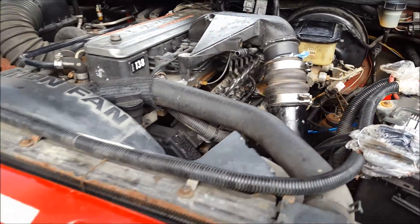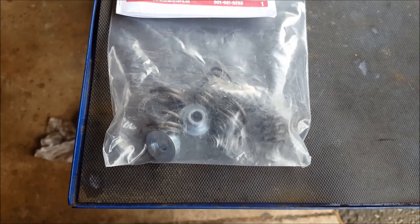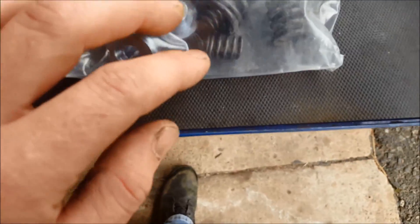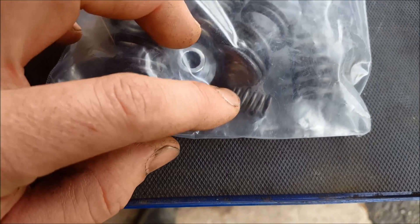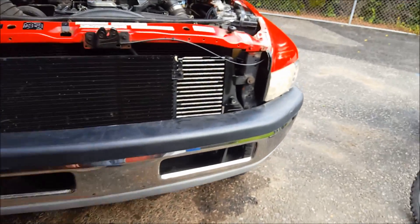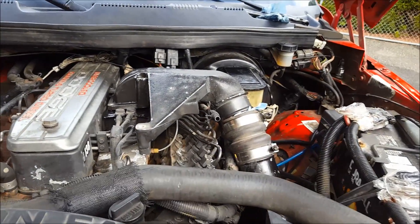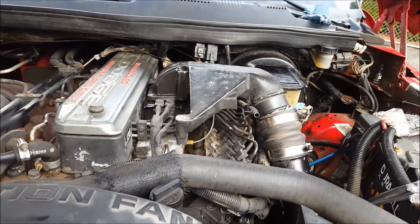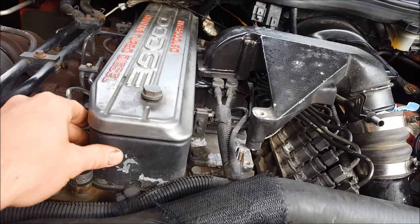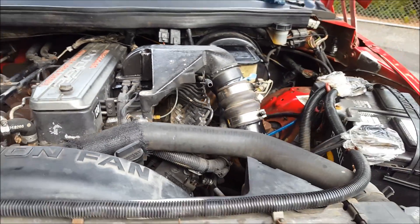Not going to go into a ton of detail, but I'll show you guys the basics. I decided to just get a kit instead of shimming the stock springs because these are cheap enough — I'll put a link in the description. I'm going to do the 3K kit, so I just don't install the small ones on the inside. That's going to increase my defueling point from about 2200–2800 RPM up to about 2800–3400 RPM. You can put the 4K springs in, but this isn't a race truck. If you do that, replace your valve springs with the 60-pound springs, otherwise you risk catastrophe.